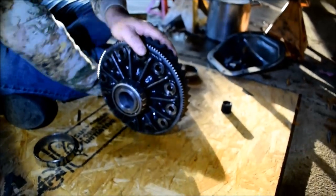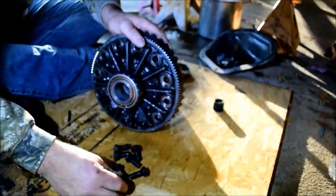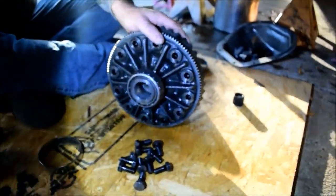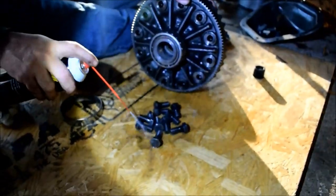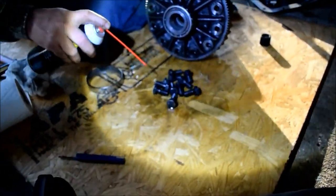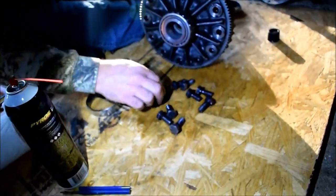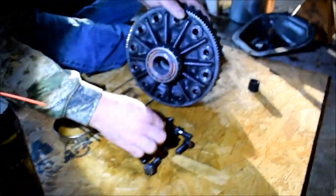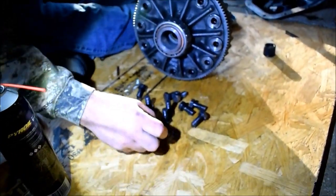Loctite can't be fully effective unless it has all grease and solvents removed, right? Yeah. Watch that brake cleaner. It's a little bit on the, how would you call it? Stays behind too much. For some reason, that brand of brake cleaner likes to stay behind. You mean pulls moisture? Yeah. It doesn't really evaporate as much as other ones do. Most solvents pull moisture unless they have certain detergents in them.